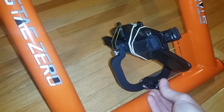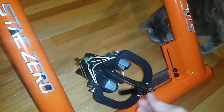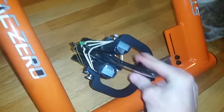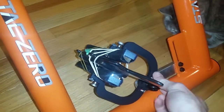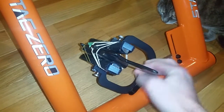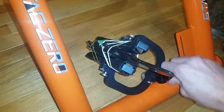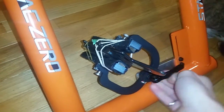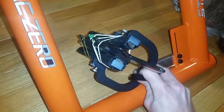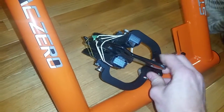Now that I've got this in place, I'll just loosen the quick release and let this kind of flop over to one side, and you can just unthread this just like a normal bolt. This is quite challenging to do with one hand. Once it's out, you'll want to make sure there's a washer on the end — make sure you don't lose that washer. This washer just helps with how it mounts in and gives it the proper feel with the quick release.